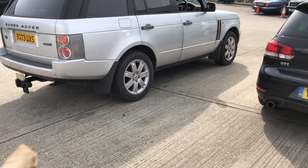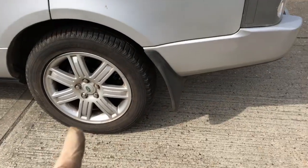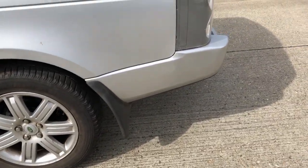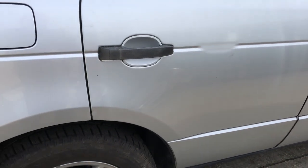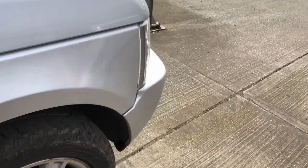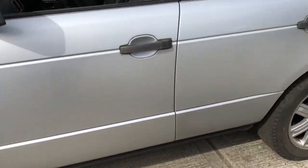The suspension looks like it might be at access height but it says it's in normal height — it probably needs calibrating. It doesn't bind on this side anymore which is good. I've done both the rear tires — took them off, new valves, re-beaded them, cleaned up the corrosion, put some special bead sealant around the wheel, pumped them up. Those two should be fine to keep an eye on. The other front one I think is fine. So that's all of the underneath done.